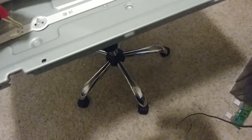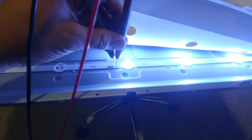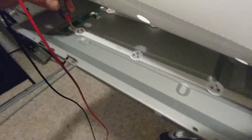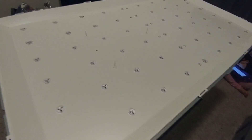I can jump over to this jumper here and test it from there. I see this working fine. I could go back to this one again, but yeah, it doesn't actually work out. So I'll replace R2, and then this one here is L1. So I'm going to replace those two, test them out, put the TV back together, and then we'll jump over to the upgrading process.